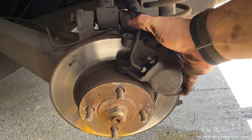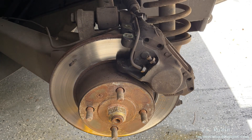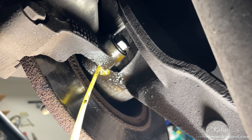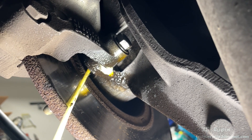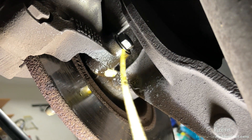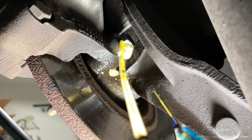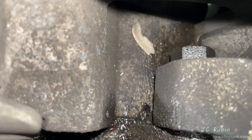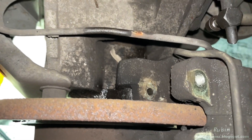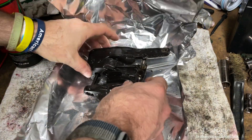What remains on the car is very similar to the front brakes — two bolts in the back secure it to the car. I'll be adding penetrating oil to those bolts in three places: right where the caliper meets the car's assembly, where the thread of the bolt pokes through the other end, and at the head of the bolt. This was done a couple of times the evening before I start the work, and it was also done to the top bolt.